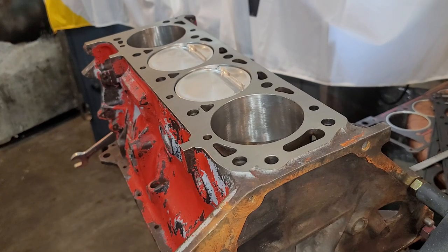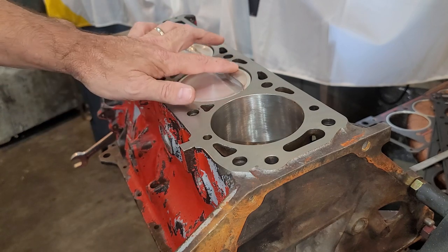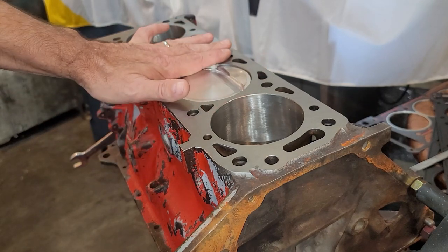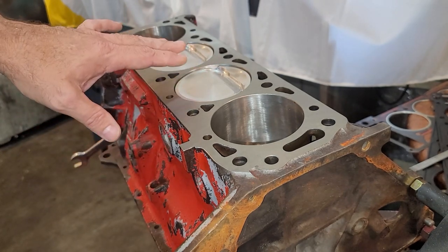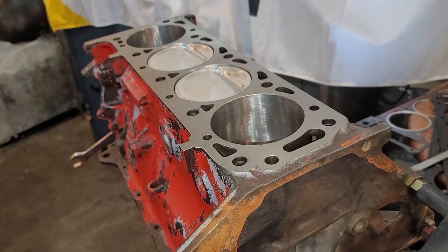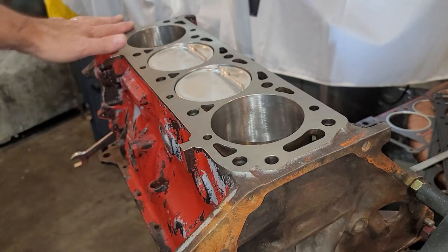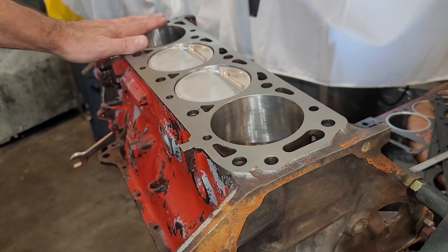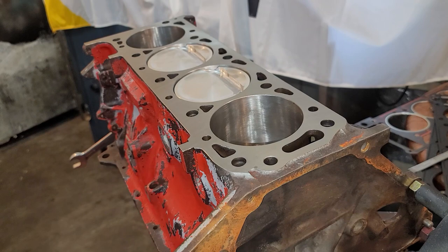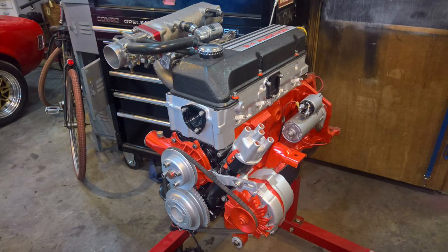That's why we're doing this video. So what is tolerance stack? As you can see here, this piston is sitting below the deck by a millimeter. This is how I wanted this one to be, because the 2.5 was flush against the deck — that's going to lower my compression and should help. That happened because the 2.4 liter block and crank has a rod that's 134mm and the 2.5 has a 135mm rod. So that one millimeter — you see the difference right here at the top of the head. The real stack comes in from decking: the block here is nice and clean and decked, same thing on the head. You do both of those things and you might be surprised to find out that's going to affect your compression ratio.